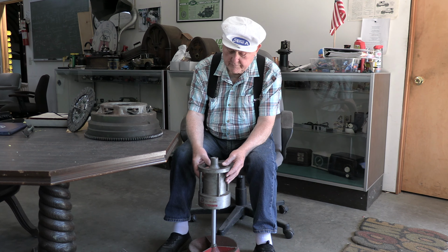Then, once you have determined that, you've determined what it is in this position, so be sure and mark. What I like to do is take a punch and punch a punch mark on one side and a punch mark on the pressure plate, so you can line those up. If you mark them with chalk or something, then you sit around for a while, and eventually that chalk will get wiped off just from handling. So it's best to do a punch mark and make it big enough so you can see it, so that when you put this back together, you can get it back in the balanced position.